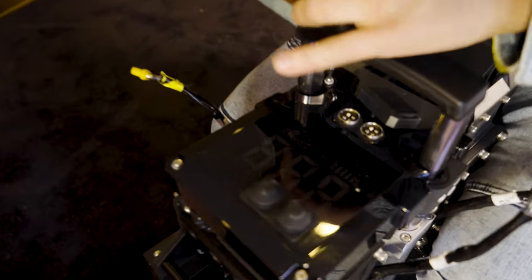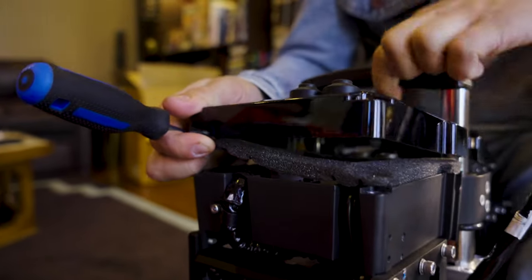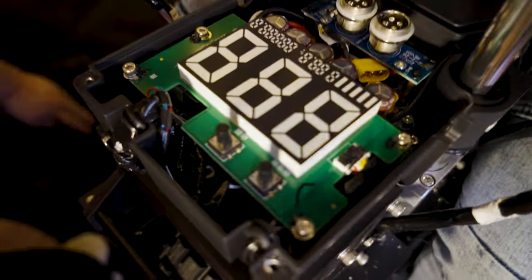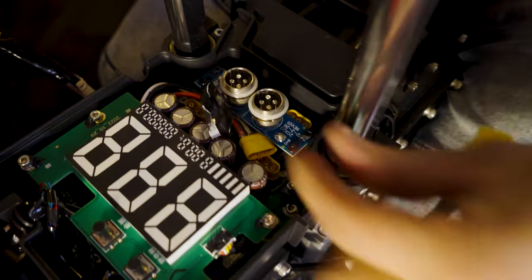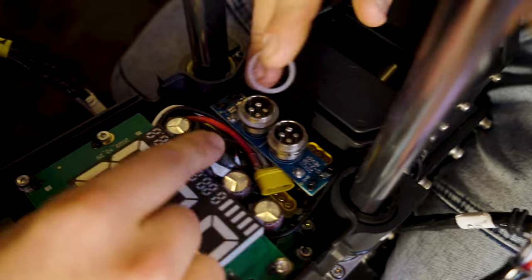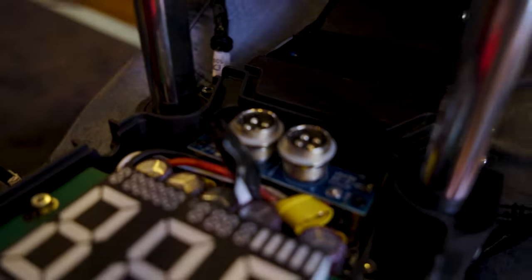Opening the lid, we can see little O-rings for the charge ports. We'll make sure those don't go out of place. This is a number one spot for water ingress on this wheel — when you have your charge door open and you're charging outside if it's raining, so those O-rings are important.